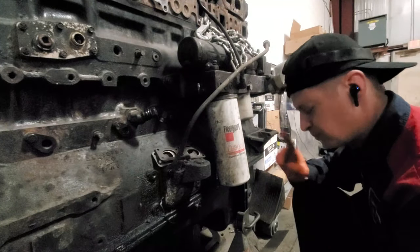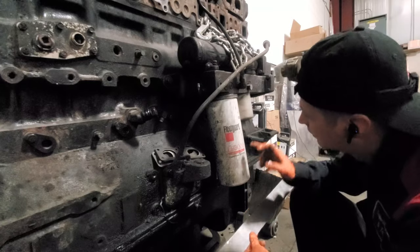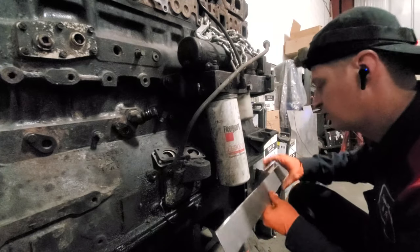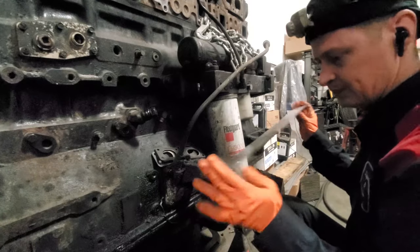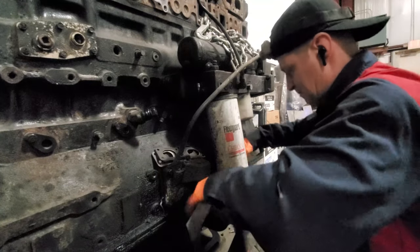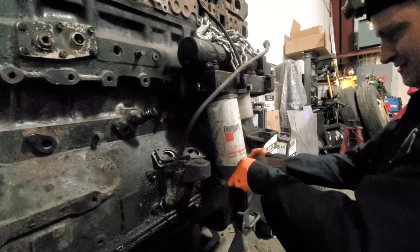The distance over here — what is supposed to be the oval around the drive shaft — turns out to be five inches in diameter. Apparently this filter over here is five inches in diameter, and we have this old engine sitting over here, so what I'm going to do is bend this piece of steel around this filter so that way we have a perfect five-inch bend, which will make it much easier to finish everything off.